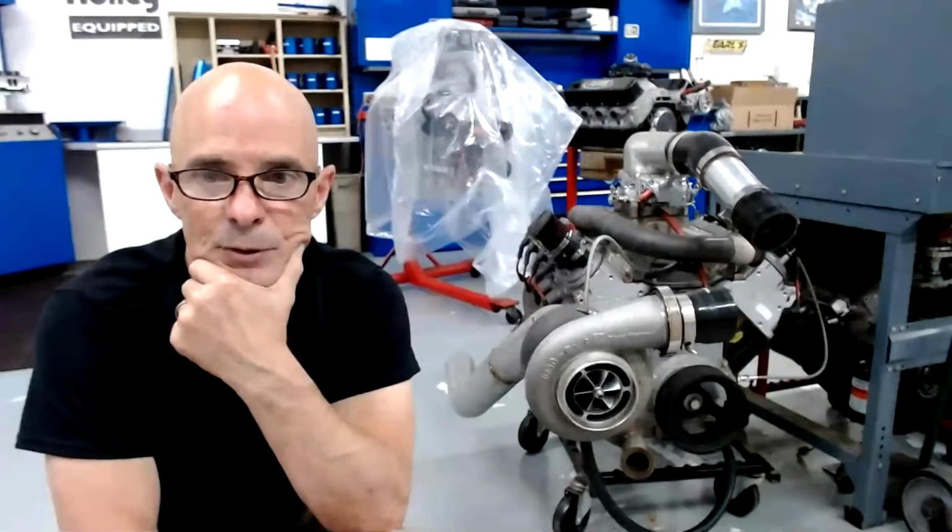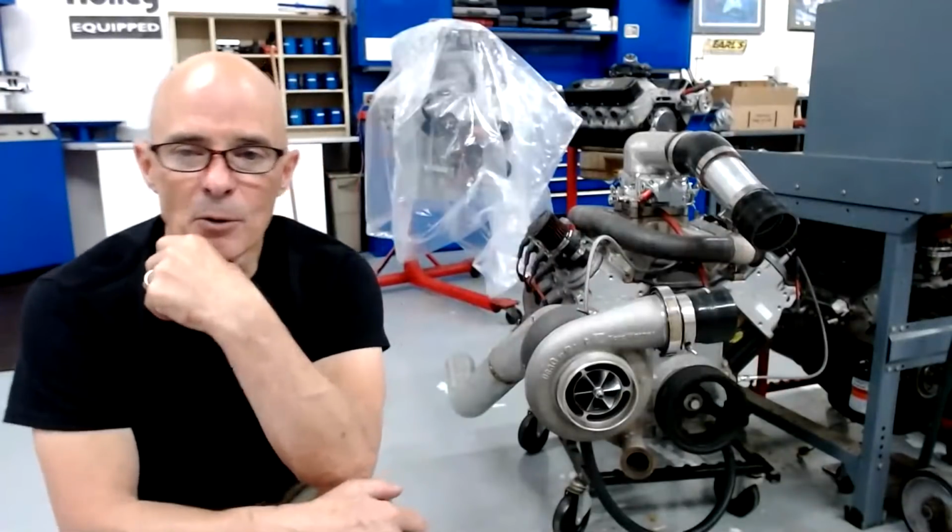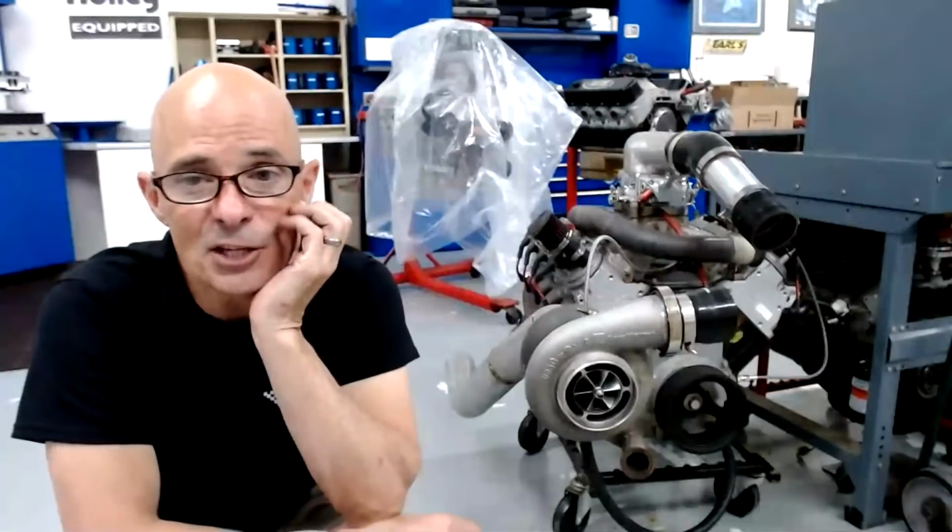Let's see, 5.3 Hobby Stage 2 TBSS 4L80 FT1 3500 converter, street truck versus racing billet S480 or 7875. How much power are you trying to make? I mean, the S480 will have more power potential, and I think that you have enough converter there for the S480.